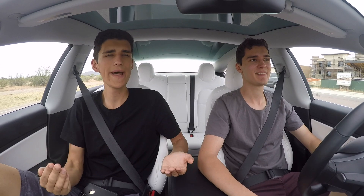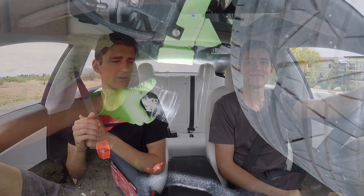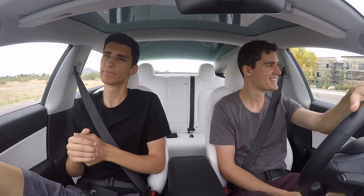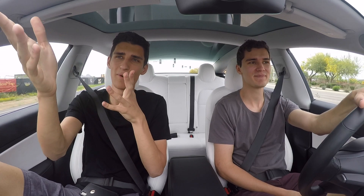So boom — that's awesome to hear. I can't think of anything better if this is really all back in business. If you guys remember, we were having the problem where the fuel pumps would not run. We were wondering about the alarm system, the immobilizer, because we know that kills the fuel pumps on cars — maybe with the battery going so dead for a while. But we tried reprogramming that key fob and we got the key fob to work, but we were still not having any luck, so it was something more. So let's go see what Kyle found. Maybe later today we're gonna do an oil change, maybe throw the bumper back on because you guys were demanding the bumper go on. Yes, I'm sorry for the people who wanted it off — you did not comment enough. Actually you did, there were hundreds of you, but I'm sorry. So anyway, he's just moments away.